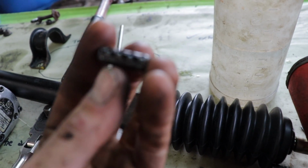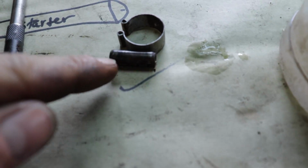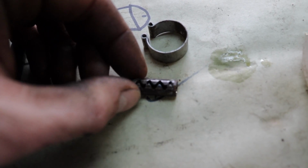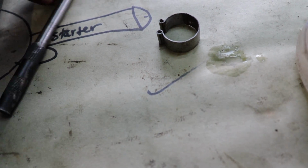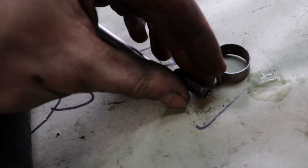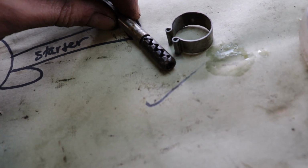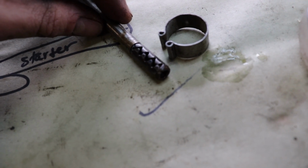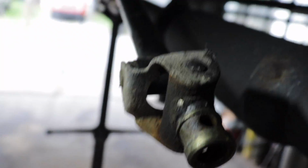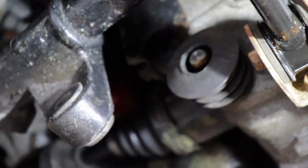So here's what the drift pin looks like. Put it on the ground here. So you see how it has this break in it here. And so that collapses when you put it into the slot. And then you can see how the ball of the punch actually goes into the hole there. And it's the perfect size and it just slides right out. So then he's already got it off. So that was the hole that it was in. And it just slides over that shaft in there.